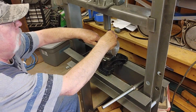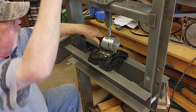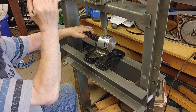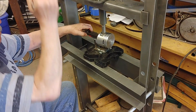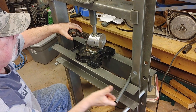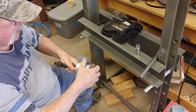So anyway, we put the pin in. You heat up the rod to slip the pin in, but we didn't have a jig to stop it at the right alignment, so we were just kind of free handing it. It got cold and the press fit took over, and then they're really difficult to move after that. We tried to push them out without the jig and we sort of tweaked that piston just a little bit. We tried to put a socket to cup the bottom, and you can see it doesn't rock smoothly like it should. I pushed a little too far — it is not good.